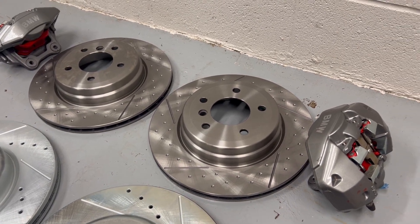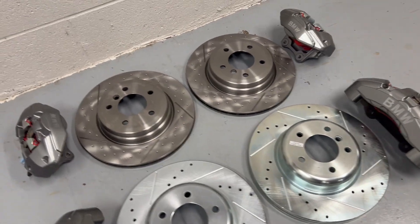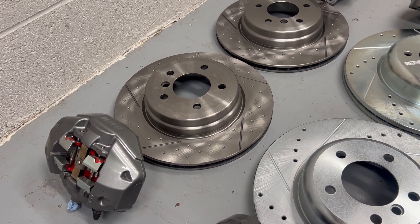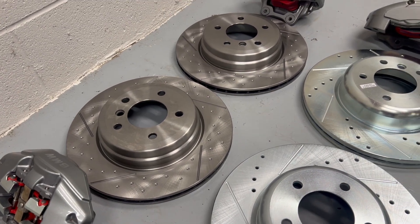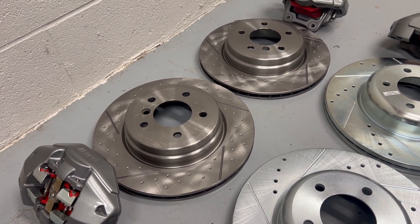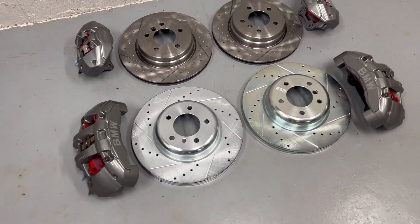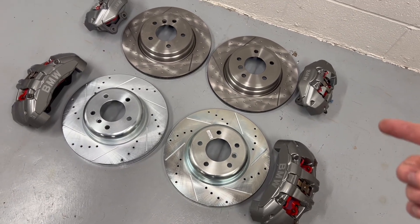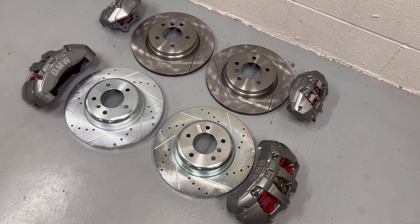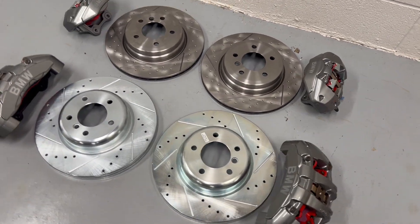I feel like you don't see a lot of E90, E92, E91 running these brakes because the rear rotors are pretty expensive — OEM rotors are $200 plus per rotor. I did some cross-referencing and managed to find an aftermarket company that is still making the 324 millimeter size dimpled rotor that comes on the OEM sport package brakes, which is essentially this exact same setup except powder-coated yellow instead of OEM gray. I'll put the part numbers in the description — this is a very budget big brake kit for my E91.